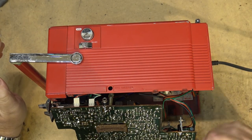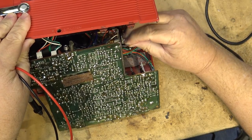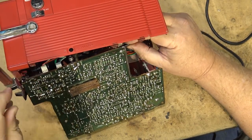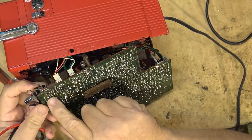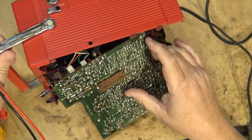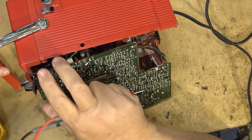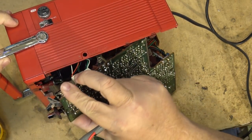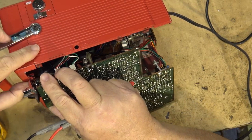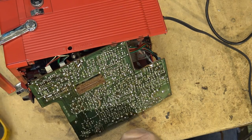So that's what we're going to check out. On the power supply at the back here, there's a black, brown, and red wire bundle leaving the power supply. That's going to be the DC power that goes up to the board, and it actually goes up to connector number one — CN1 — you can see it right there. That's the power wire. So when I apply power, I should have power on probably the black and the red wire. Let's see which one is which.